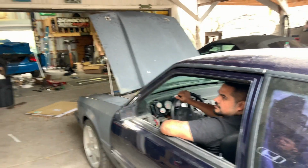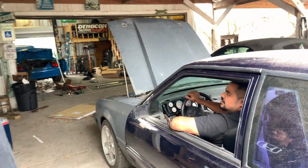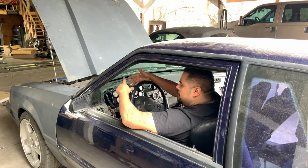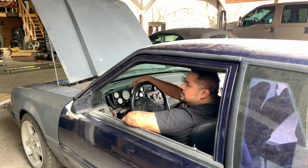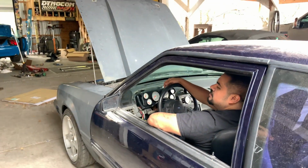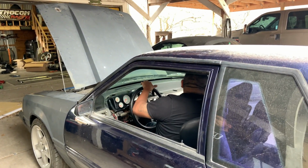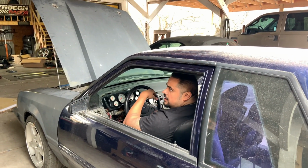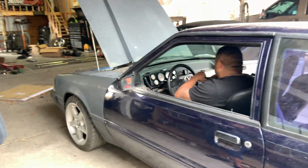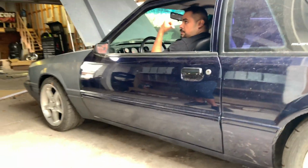Hopefully I can save some money so I can change it to a standalone. You know, standalones are pretty good for these types of cars. Especially if you get a Holley kit with speed density and the wideband sensors, that's awesome. It's a little bit of money, but it's so much more user friendly. Especially if there's an issue, you can always check the wideband sensor. The Holley is almost $3 grand. That's not that bad, with the harness and everything. So the battery is off, right? Yeah. Okay.